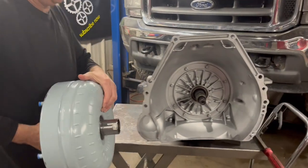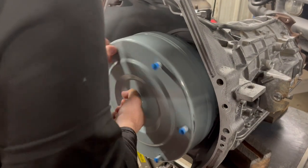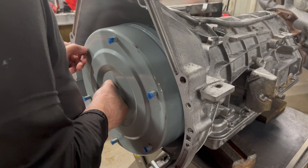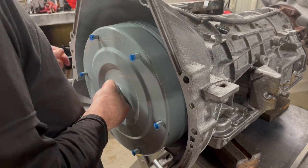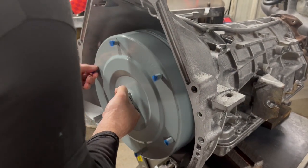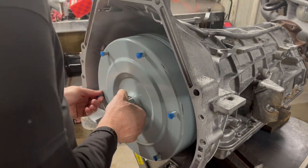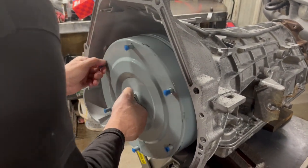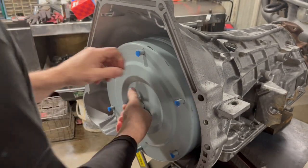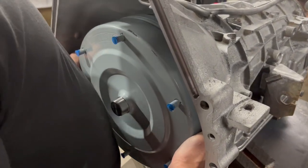Get it run back in — it's a heavy converter. I usually like to just kind of spin it around until I hear that click, then back it up a little bit. You see how it went in? There was one notch there, and we got one more notch to go, which is the pump. You can hear it moving the pump, but it's not in it yet. There we go — you hear that? That's the sound you want.